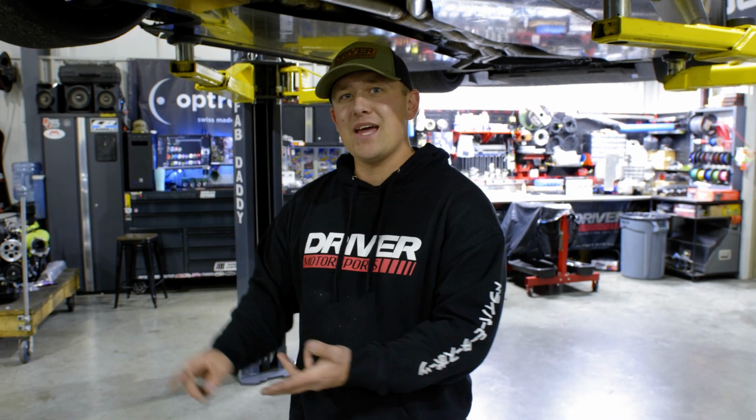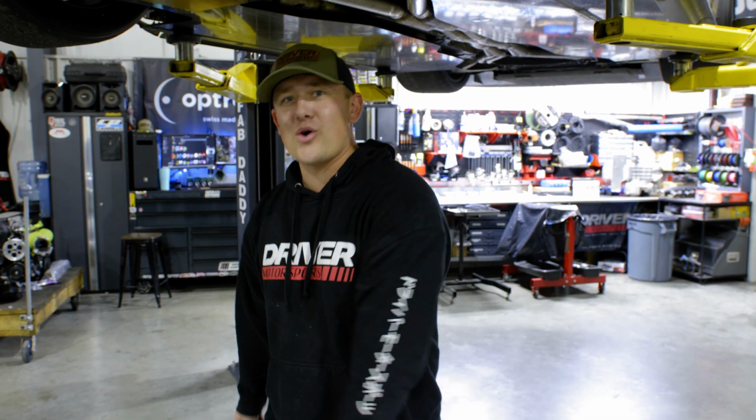It's a really cool car. It came from Japan with an R154 swap already and a single turbo conversion. So it was a 2J Greddy single turbo with an R154. All it was missing was a good ECU. So we went ahead and put that on for the customer, and it's doing pretty good. We haven't really turned it up. We're leaving it on wastegate, which is 8 pounds, and it's making around 300 horsepower, which is plenty for that thing.